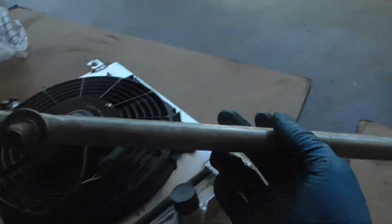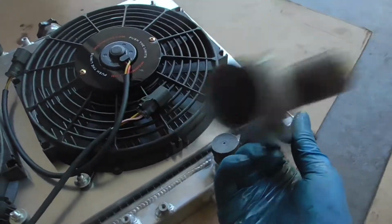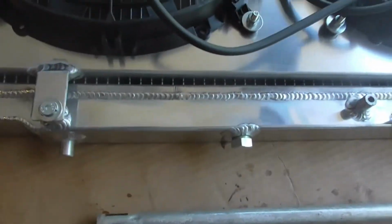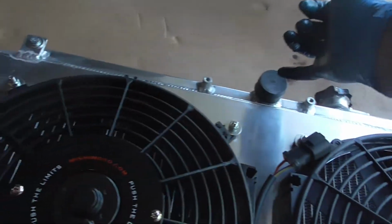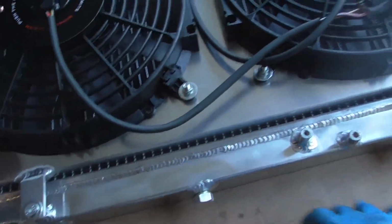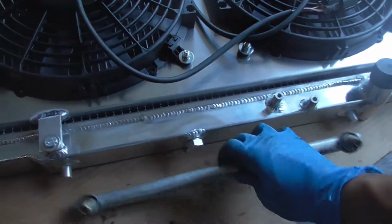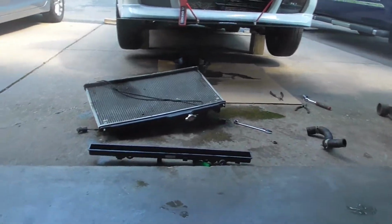So with any application that has AC, if you guys are doing something like this, just take it out, because it's basically nothing. It's just a plug, and the reason why it goes under the coolant is so that the hot fluid comes in on top. As it goes down here, it falls down and cools down, goes to the bottom of the housing, and then the coolant runs through here, and it actually just cools down the oil that's inside those high pressure hoses and stuff like that.